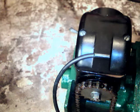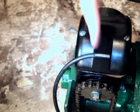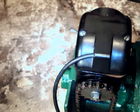This video is to show you how to time up the Lister D magneto. We're not talking about engine timing — we're talking about the actual timing of the magneto rotor with the points. It's probably best if I just show you, because a lot of people think the magneto is gone, the coil's blown or the condenser's gone, when there's actually nothing wrong with it. The magneto just isn't in time with itself.